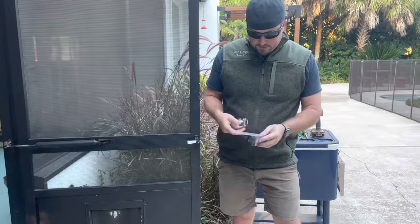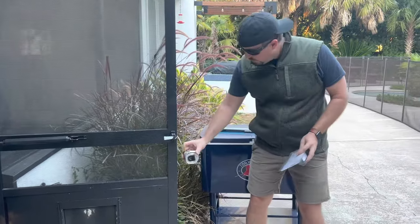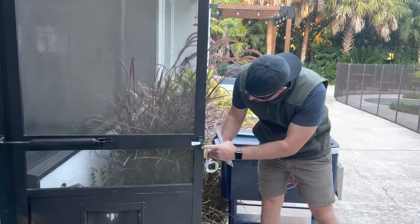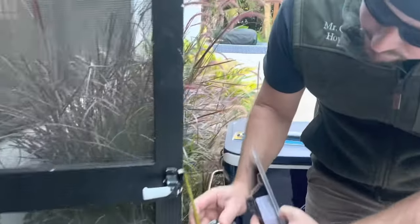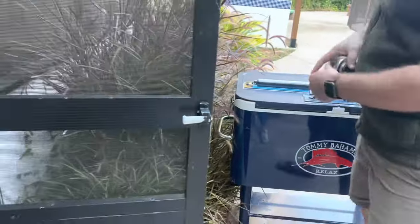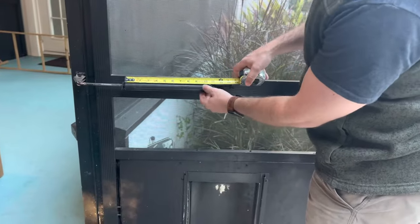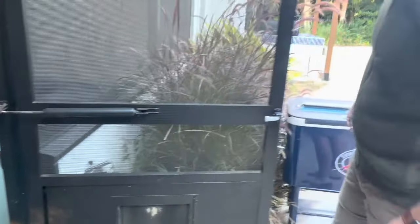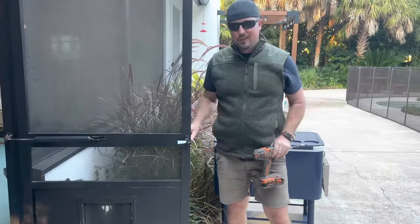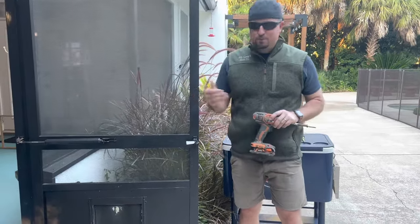In terms of figuring out which size you need — we went with a colonial style — you need a one and three quarter inch hole. Measure the hole and see where the two screws are holding the door handle, confirming it's one and three quarter inches. Also measure the length of your gas strut, which is ten and a half inches here. A screen door should be light duty, and that tells you how much force you need in the closing mechanism.